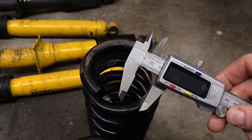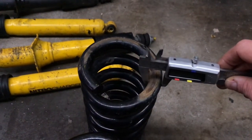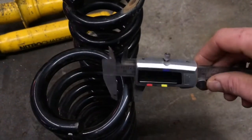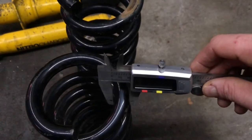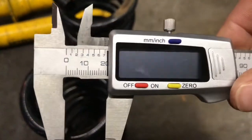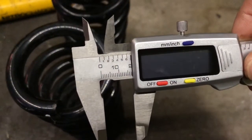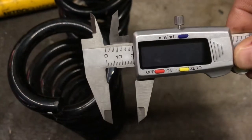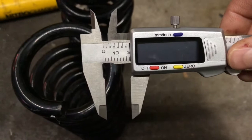Well, then my calipers run out of battery. You can still do the comparison here. Run that against the ARB spring and compare it against the standard. Can you see the flexibility, the movement? The ARB there is 20mm thick. We'll bring that back down. The standard stuff is 17 or 18mm thick. It doesn't seem like much, but it makes a big difference.